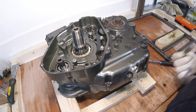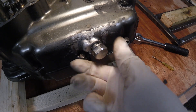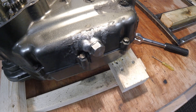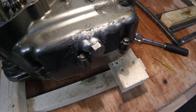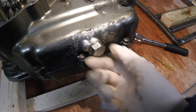I've been through all of this and I've discovered a problem. The oil drain plug sticks out significantly from underneath the casing, so if you're going to bottom the bike out really hard the ground hits the bottom end of the casing here and cracks on the leading edge of the oil drain plug, cracking the casing — which is what's happened here.